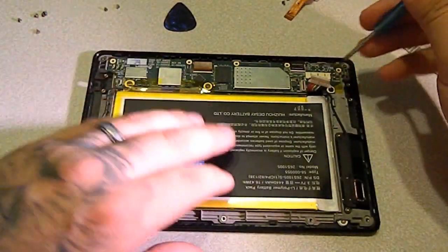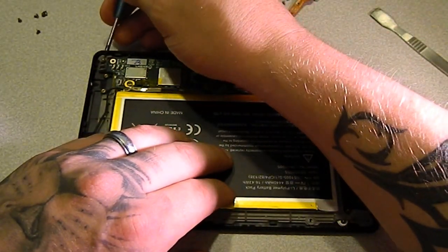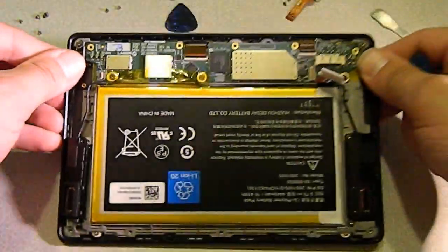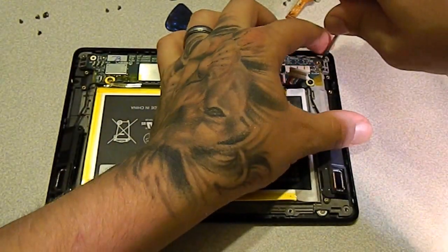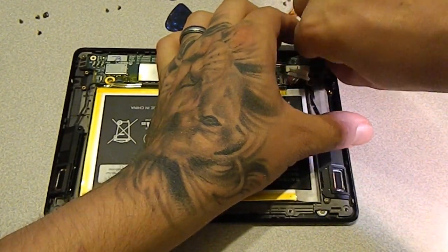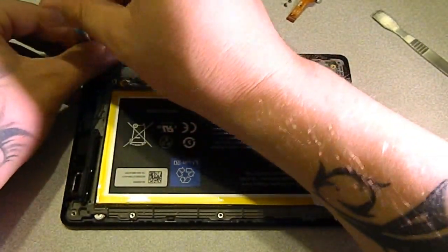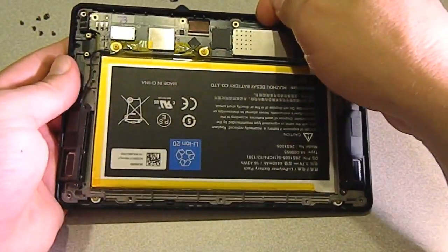Oh, actually, we have 2 screws. One for the frame here, one for the frame here. I always forget those. If you can't see, we have one here and one there. So pull those out. And anytime you're pulling anything apart, like the frame and the circuit board, always pull gently, because you might forget something, like those 2 screws, and you don't want to force things because, well, they break easy.